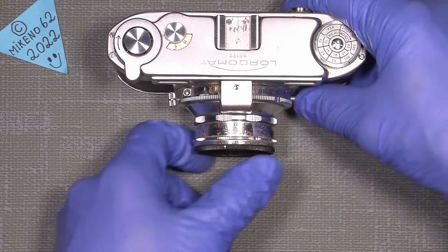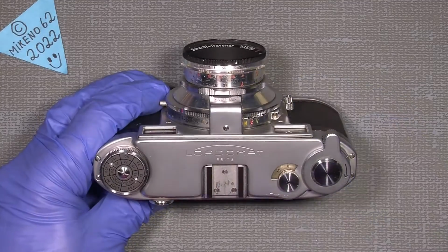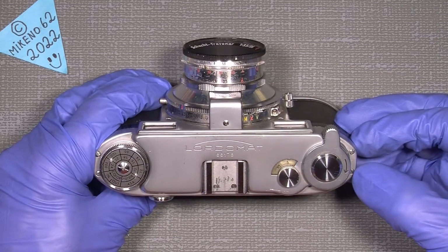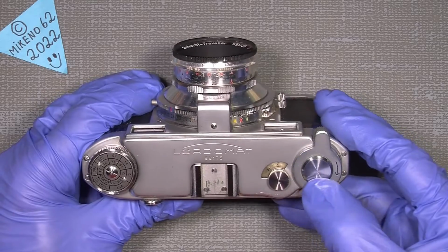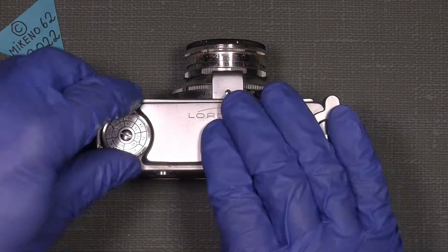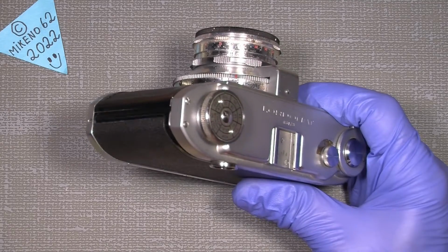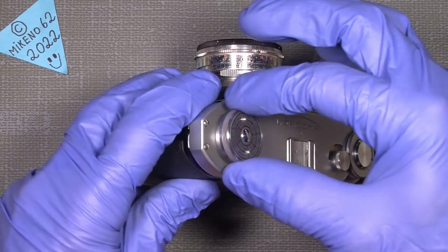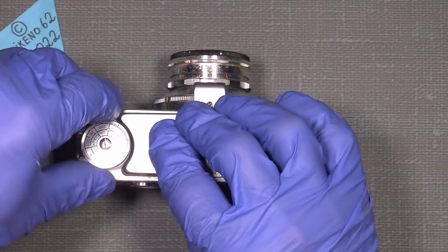But let's have a look. We jump into it. It's quite simple. I need to take off the rewinder, the two screws over here, the two screws over here, and of course the shiny screw with the advance, so there are three screws under here. And one thing is important: if I lift up the rewinder thingy, there is a small spacer underneath the rewinder button. I will show you soon. So we can just start with that.